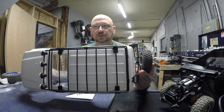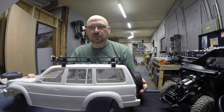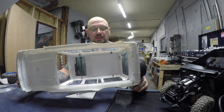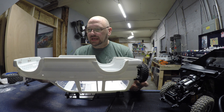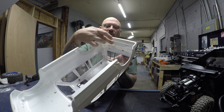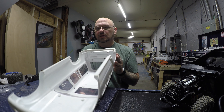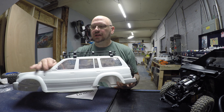I have some knockoff lights I might not run bulbs in — I think it looks cool without them and I don't want to drill another hole in the roof. The roof rack mounts with four screws per tab with nuts, and you get a cover to hide the screw going through the body. When I drilled the mounting hole, since the windows are all one piece, I drilled straight through the glass so it won't fall out or drop into the interior. The rear mounts all go through the body with little nylon lock nuts. This will eventually get a full LED light kit with corner markers.